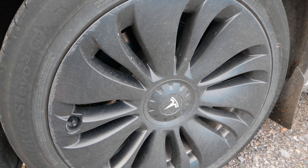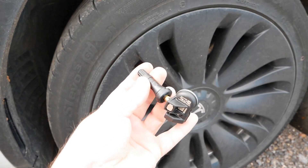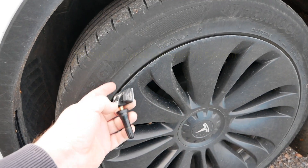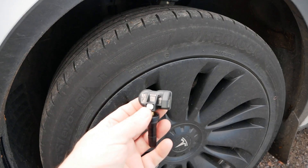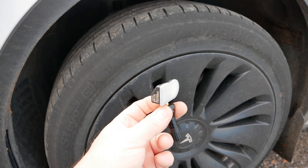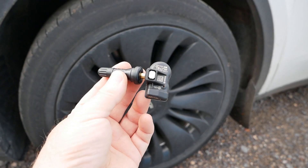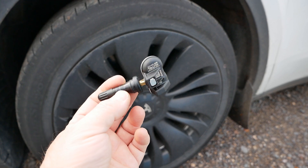On all modern cars, behind the tyre valve is a pressure sensor — it looks like this. It's called a TPMS valve, which stands for tyre pressure monitoring system. That sensor sits behind the rim inside the tyre, measuring the pressure and sending it back to the car. It has a coin battery inside which is sealed and can't be replaced, which is why these have a life of only five to eight years typically. They're activated by motion, so when your car is parked and not being used, they aren't transmitting in order to save battery life.